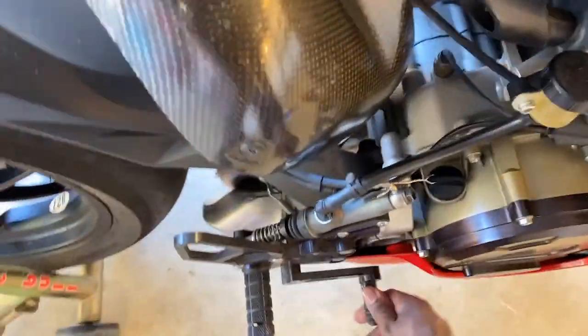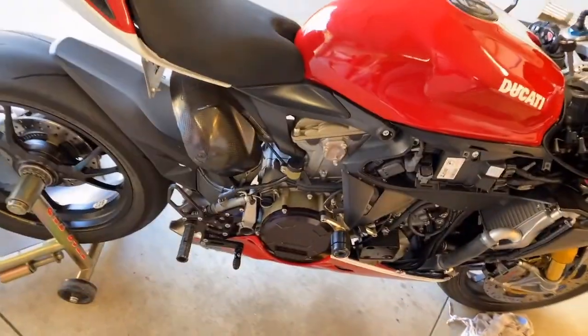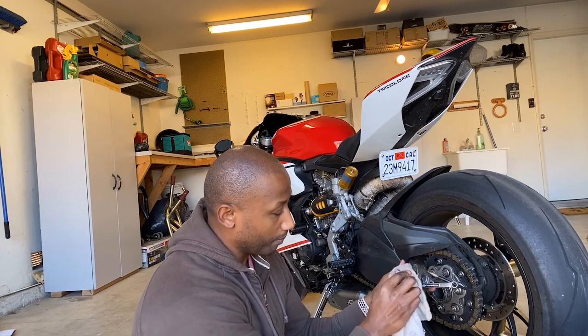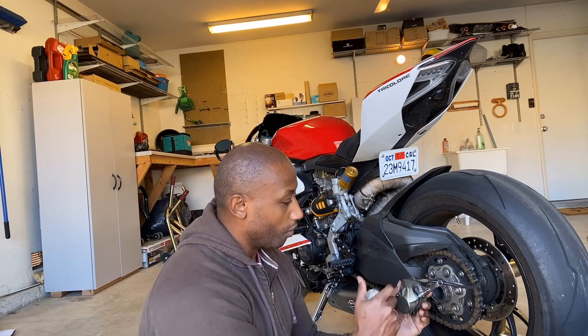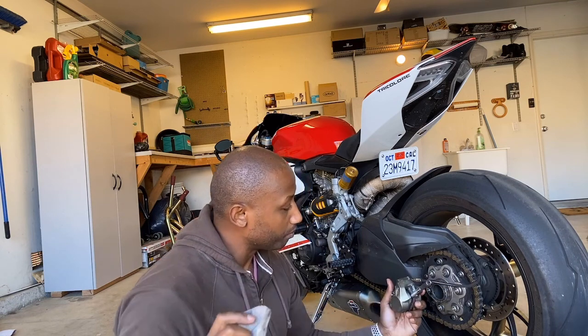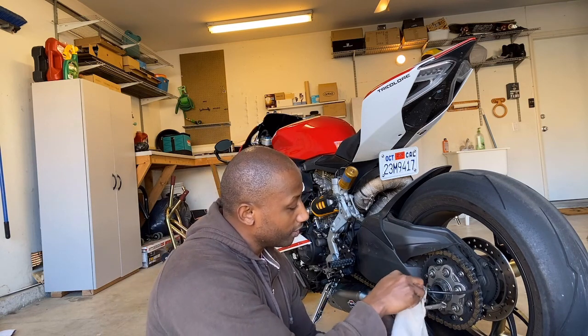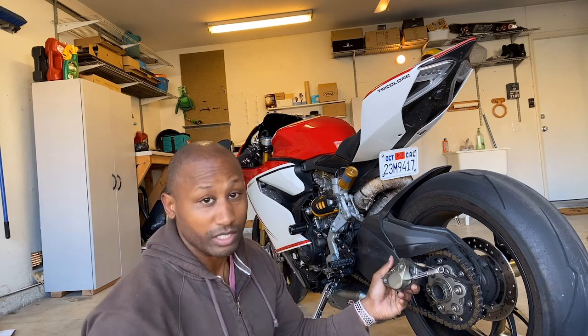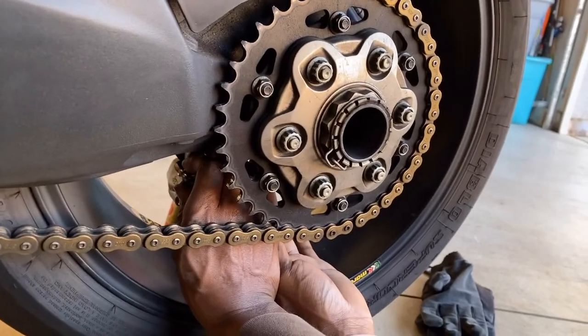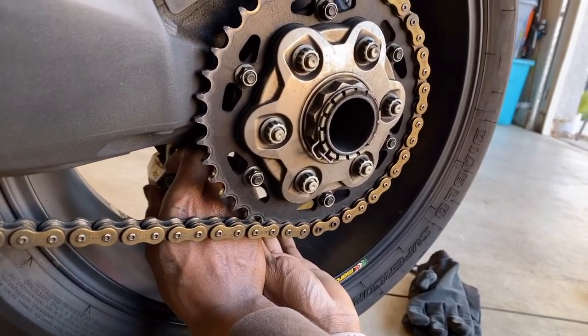Everything's good, brake's good. Now I'm about to install the rotor back. And I got this wrench in here, somewhere where we're pumping the brakes, so the piston won't move out and lock the brakes shut. So I just stuck a wrench in here. All right, and I'm just putting these bolts in to put this caliper back on.